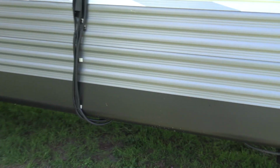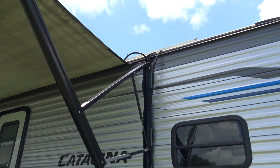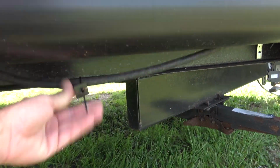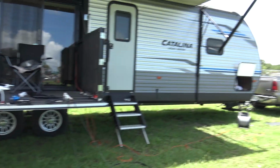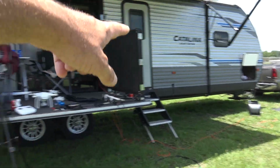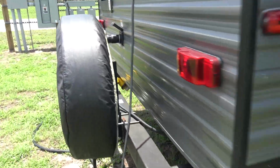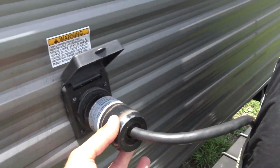Now, this gives me excitement because, for those who don't know, I have the wires running up here, which a couple of them broke. I tried zip tying on the way here, the wind, okay? And from those, so that inverter here, I ran the wire underneath, which I could just see now this one came off. Tie that up, but I got it under the frame. It's not gonna come out, and it's a mess now, but I ran the wire all the way underneath the frame rail, and I came out here. And why did I do this? Because I did not want to modify anything in the breaker panel. So I have this 8-gauge, 3-conductor wire, and I put the plug on here. And when I'm done, I unscrew it and I shove it in this bumper here.